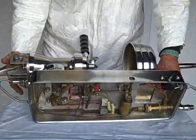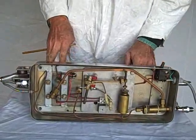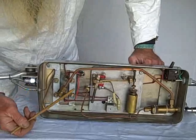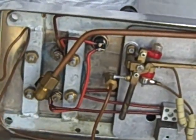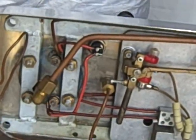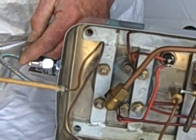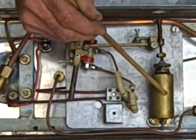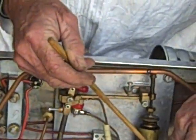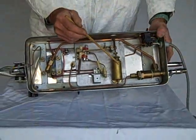It causes certain problems, but they did solve the issue of how to protect the element. The element is encased — here's the back, and these are the electrical controls to the element. It's 1,500 watts, so it's almost like a flash boiler. There's a thermal probe that sticks down into the boiler and follows down through here and around to a heat expansion unit. I haven't taken it apart — obviously this is vintage machinery — but you can see how simple it is.